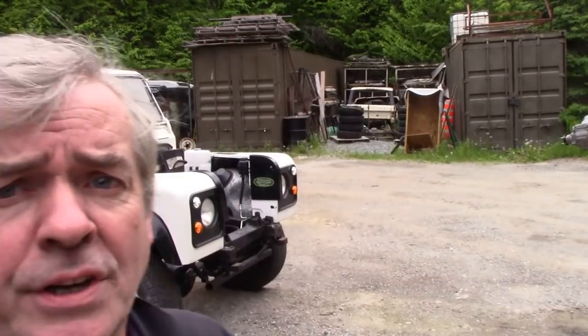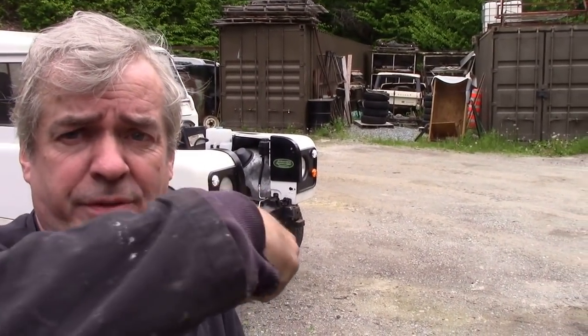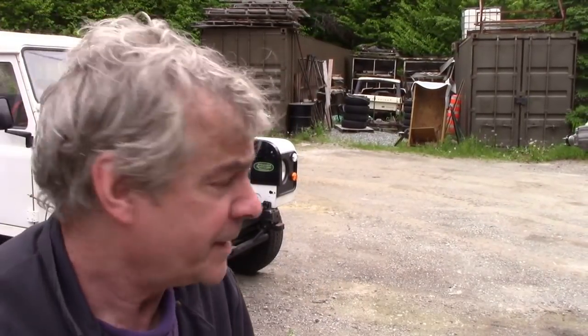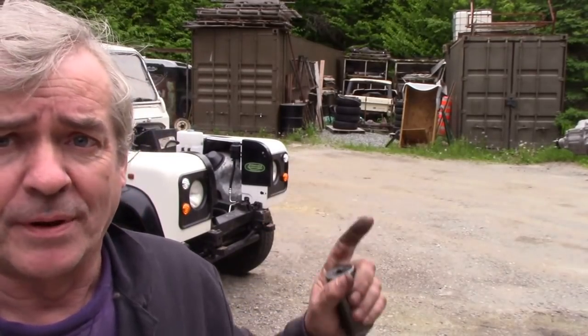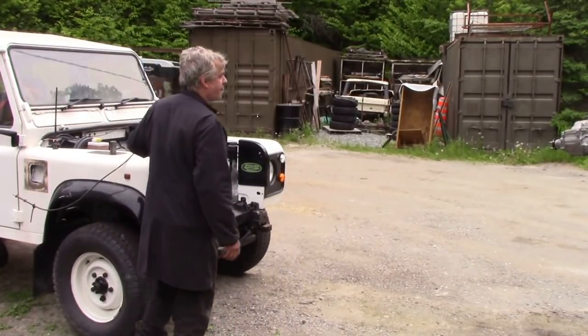Right, so here goes. I've got my gun, I've got my socket, because the engine over there is on a balance beam, so I need this quickly to move it backwards and forwards. I've got to tilt it. It's almost like putting a submarine torpedo in. Then, once it's in, I'll balance it back up again, open the doors, put my gearbox support cradle in, lift it up with a ratchet strap, and once the engine mounting studs are in place, then we can get it in the shop. Sounds easy, doesn't it? I know it's going to go wrong. Here goes. I'll leave this running.